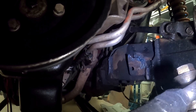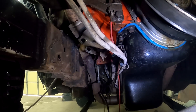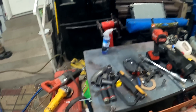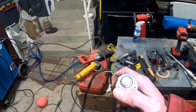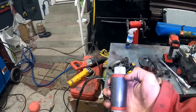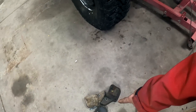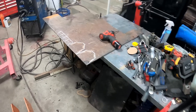Those are cut off now and we've got just the flat frame to weld our new brackets to. I've got to do a little more cleanup, unbolt those from the motor, and make some plates that'll go on there. I'm going to be using these polyurethane bushings — it's a three-quarter-inch bolt, inch-and-a-half tube. Way overkill, but I'm not going to have that problem anymore.